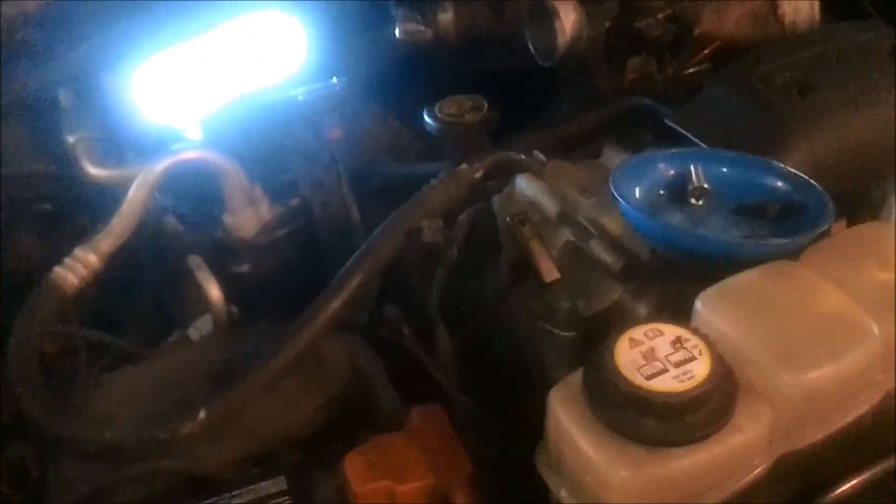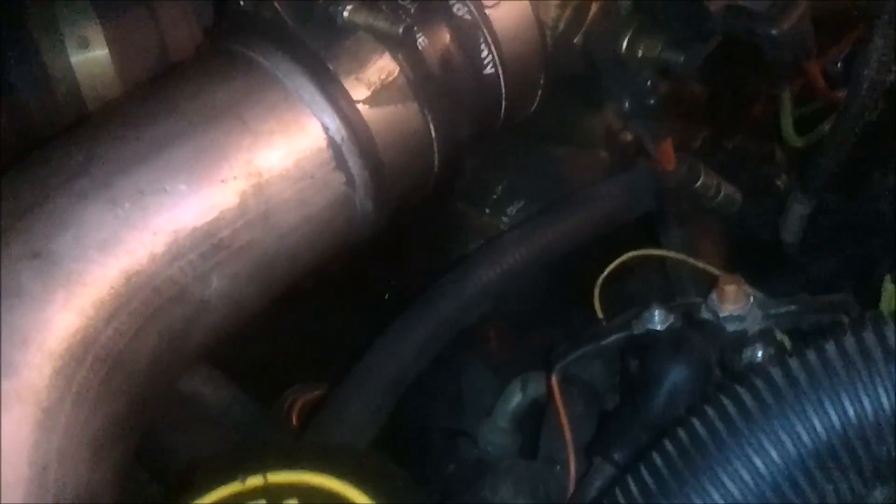So there's an update. After I get this valve cover off, here are a few more details now that I've done it and it's fresh in my mind. You've got to take this clamp down here off — there's a clamp for your intercooler. You also need to take off this little hose tube that goes up to this sensor; don't ask what it is, just take it off and fold it back up over here and you'll be alright.